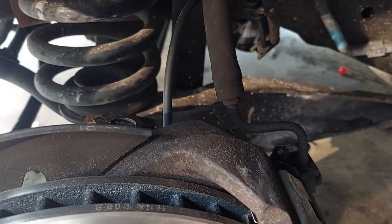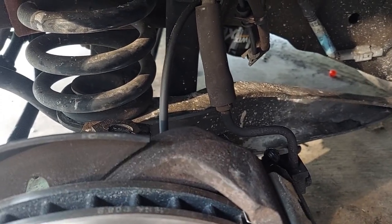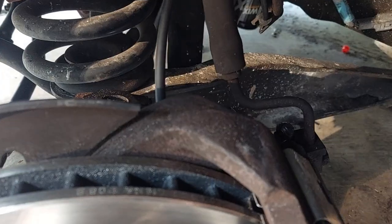This is all important because if your sensor is acting up, you don't have ABS — it turns the whole system off. And that also means that if you have cruise control, that gets turned off too. So it's important to get this working and keep it working.